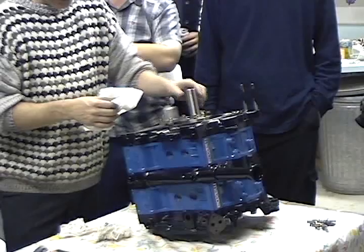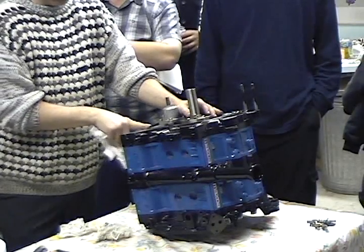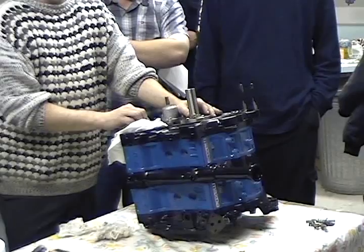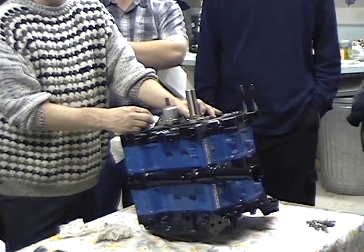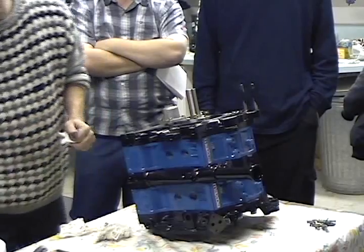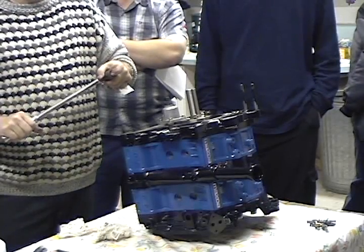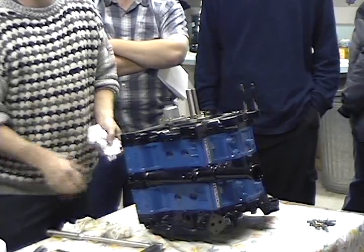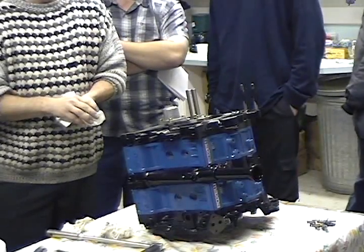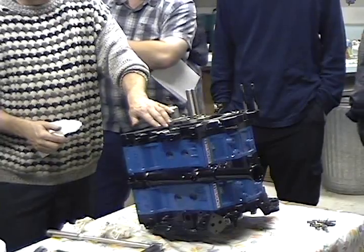I wish I had the washer to show you, but you're going to have to take my word for it. If anybody does it, you're going to be doing it. I even have parts for you if you need them. Have somebody help, or just do what I said — make sure you push that forward. A little trick: sometimes when your car is all together before you start, you can put a breaker bar in, brace it against the front cross member, and crank the starter to get that bolt loose. Because that bolt is locked tight. It's real hard to get on and off out of the car unless you pull the radiator. Try to get it broke loose with the starter first. You can change them in the car — just make sure you get the right combination of O-rings and make sure you don't lose it.